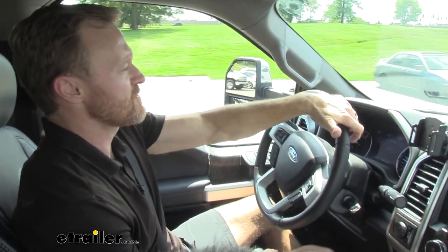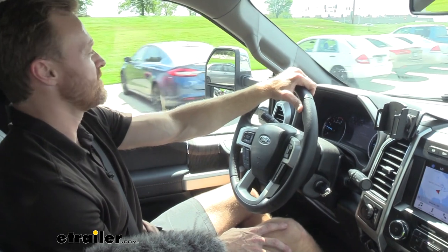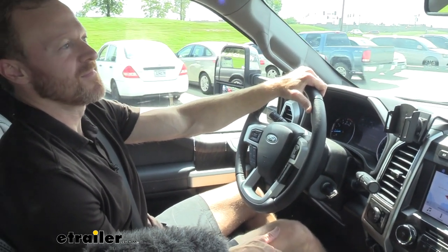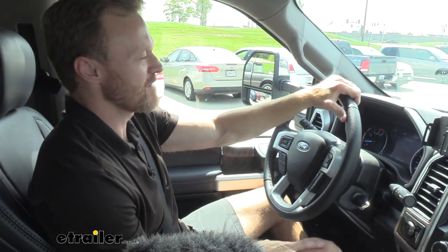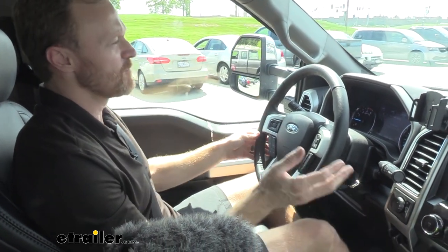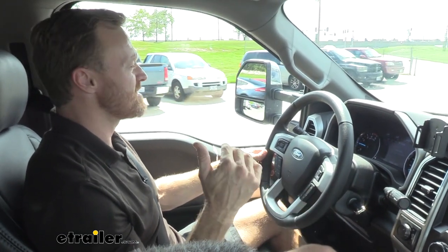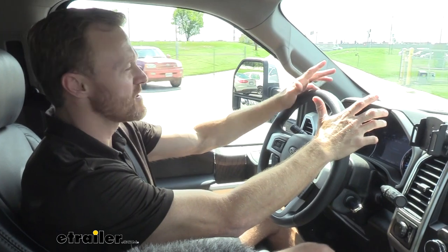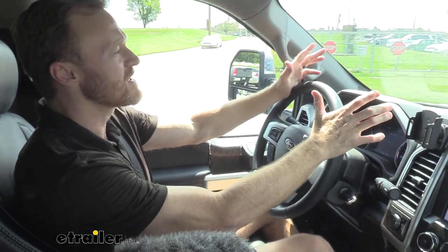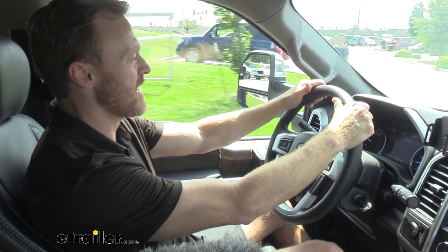All right, so now we're going to get up to 20 miles per hour now that we have a little bit of room, and I'm going to just stop real quick. Oh, yeah. Isn't that crazy? It doesn't feel like you have anything back there at all. And what I was going to say is that when you have the electric brakes, it can stop quickly, but it doesn't stop as smooth. And if a light were to change or you're in an emergency situation and you had to stop quick, in those situations, you really question if you have enough power.